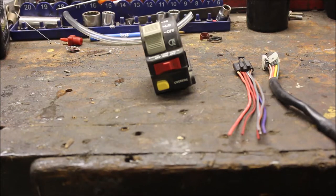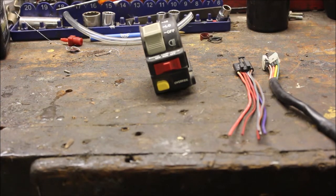I had a lot of subscribers asking questions about a crank no-start issue. A lot of times I respond and say it's the CDI, could be something electrical. In this case, I'm going to show you the importance of checking the wires going to your run/stop light switch.